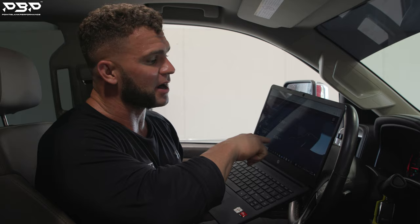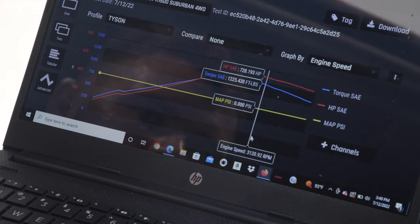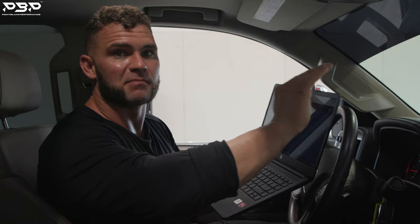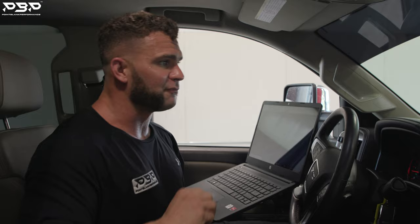We loaded the race file into it — this thing's kicking ass on 35-inch tall tires. But let's get down to the realistic business. This truck carried its power all the way over to 3,000 RPM and then said see ya. Why? Because we've got to fuel our run. We've got a 10-mil CP3 pump and a big set of injectors, so we need to pull back the pulse width on the injector to conserve high-pressure fuel so we can make a longer run and keep that steam up to make more power. Is 800 horsepower in this truck to make? We're going to get damn sure as close as possible and then call it a day.